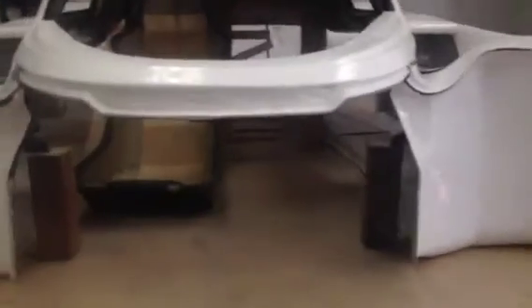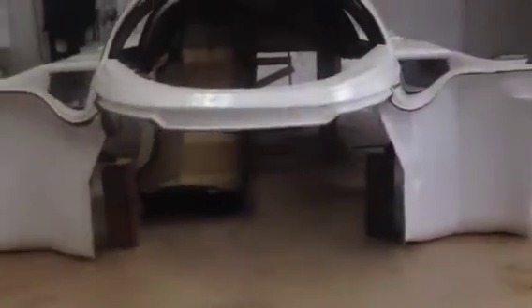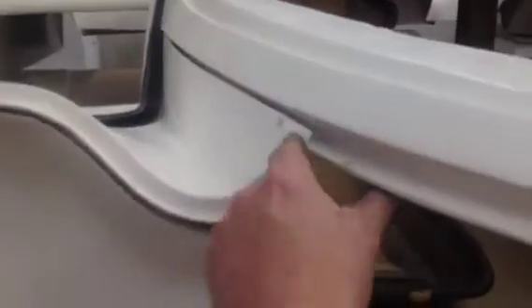The plans we do have are not particularly good - most of them have been thrown away. But I did at least get the height of where the mounting tabs for the roll cage should be: about 11 and a half inches on the front and two feet to the mounting points at the rear. So I've got a rough idea of where the chassis sits and I've basically plonked the body on. It's in need of a lot of positioning - this panel here should be parallel and flat with that. We've got a lot of work ahead of us.